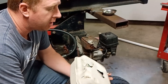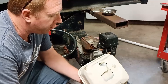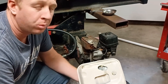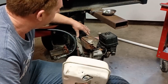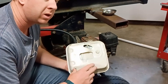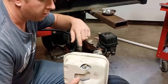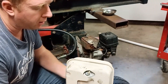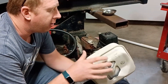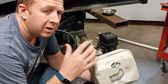I've jumped a step ahead and removed the fuel tank. It's really simple to remove — there are only three connection points. On the backside connected to the motor there are two nuts that go to two studs, and on the front side there's just one bolt, and the whole tank lifts up.